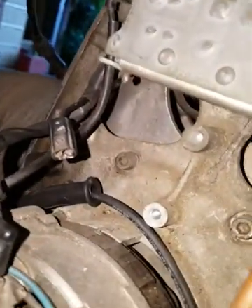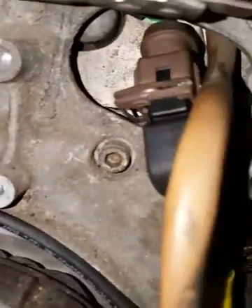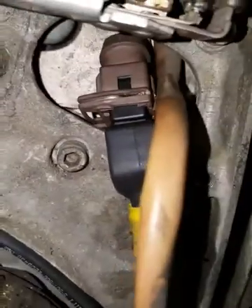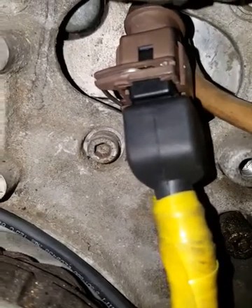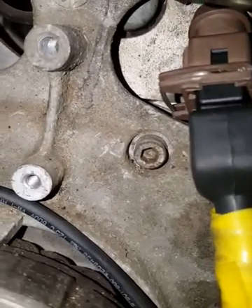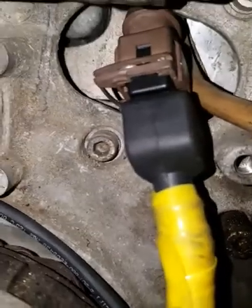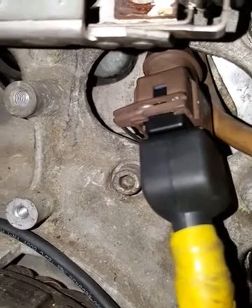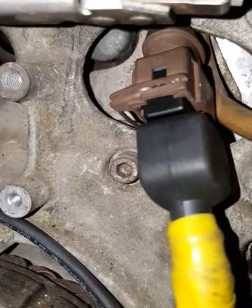The tail wire goes up the same way as with a standard electronic ignition. There's the plug for the system — you can see I've bound it with a little bit of yellow silicon emergency tape, just to save that part from chafing or brushing on the housing with vibration. The brown plug comes through from part of the harness that comes out of the ignition control module supplied with the kit.